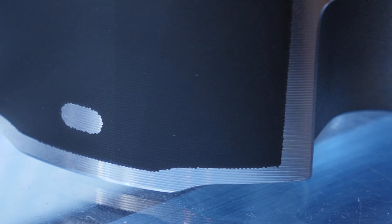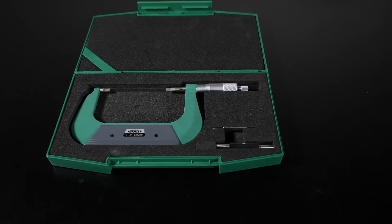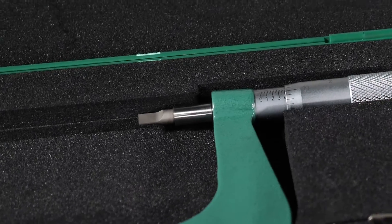It gets rid of the noise, stabilises the piston, and in effect allows you to have a better ring seal. When the machinist is setting the piston to cylinder wall clearance, they're actually ignoring the thickness of that skirt coating — so how do they go about measuring the piston? We have a window built into the skirt coating, and we prefer to take the measurement on the machined surface, which avoids any differences in tolerances on a coating — that machined surface is going to be more consistent. That's the little hole you see down near the base of the skirt through the Perfect Skirt coating. It does require a blade micrometer rather than a conventional micrometer, though blade micrometer attachments that fit onto the anvils of a standard micrometer are a more affordable option.